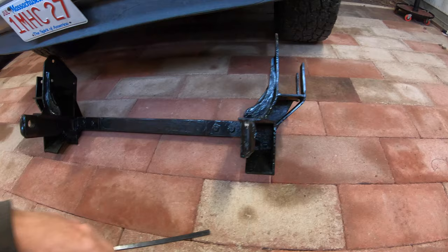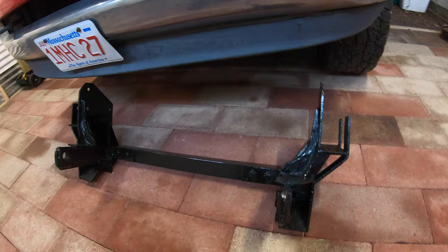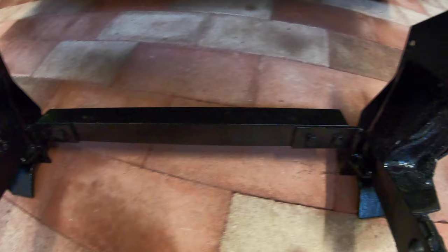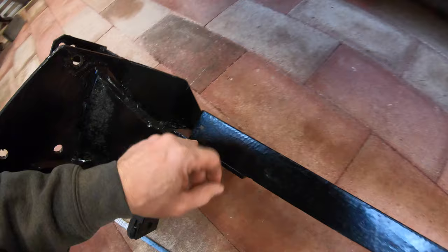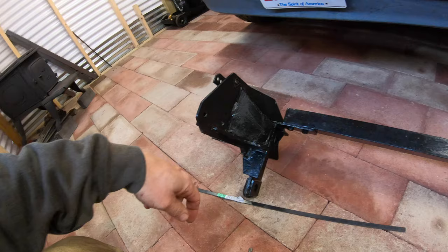I did not get the hardware with it. You can go on Fisher's website and there's a parts list of everything you need with sizes and everything. This is multiple times now I've used push plates on another truck. So this is part of the hardware here that's already connected for this cross brace, which I may or may not have to take apart. These bolts are nice and tight — they don't look like they've been disturbed. So I think I can take this whole unit as one fixture and lift it up to the frame, drill my holes, and we'll be good to go.